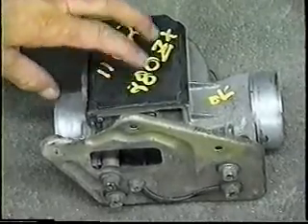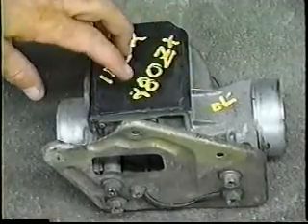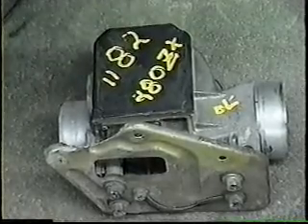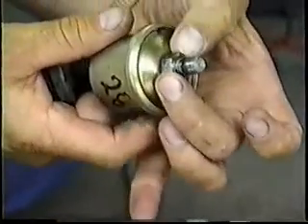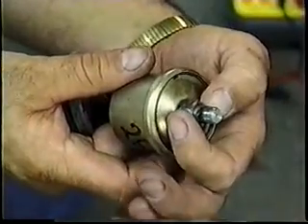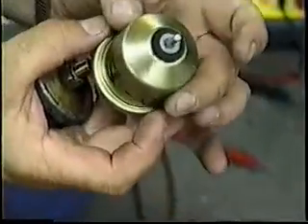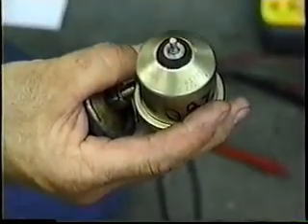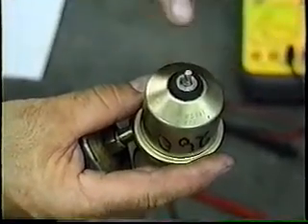If you have the five pin style air flow meter and do not have the micro switch built in, it will be using a different type of oil pressure sending unit. It screws into the block just by the oil filter, looks very similar to this, and has an eighth-inch tapered pipe thread fitting with a 14 millimeter nut on the back. Don't attempt to twist the body — always get a wrench on the nut to turn it. The five-pin version will have two flat blade contacts, much like those on the back of the master fuel injection relay.